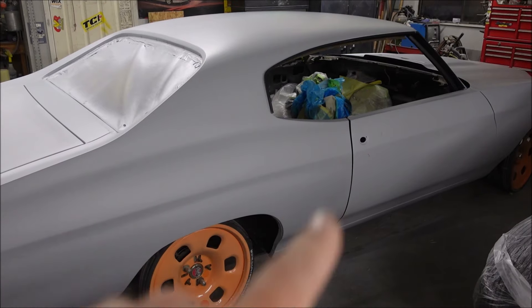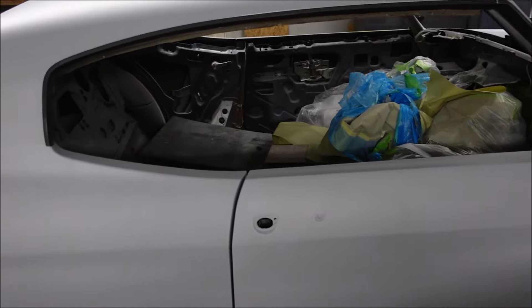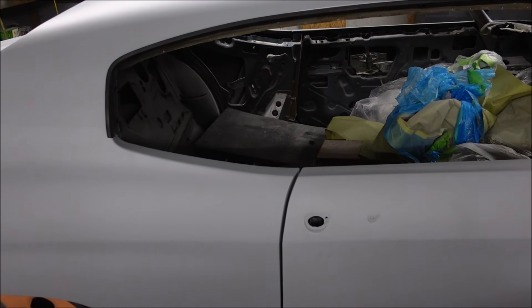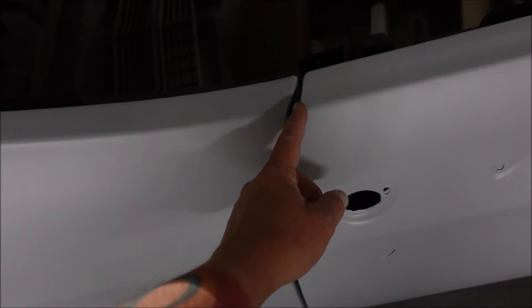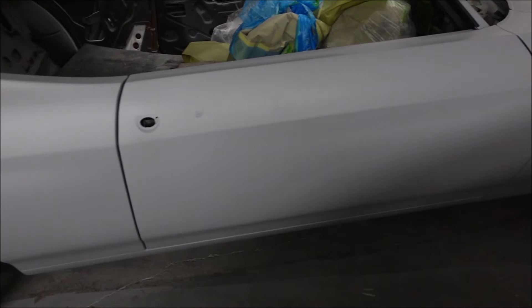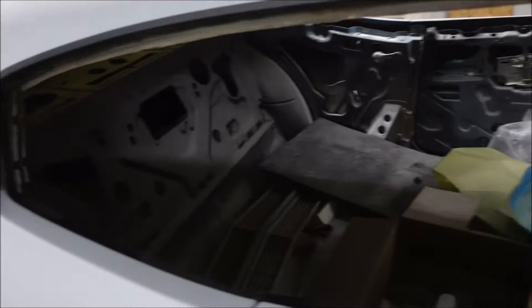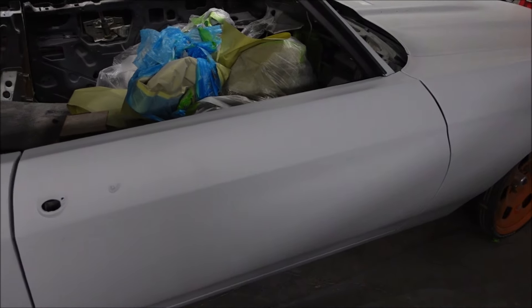You can see my big fat door jamb at the top. I made this car as good as I could without adding metal to the edges of panels to make the jambs or gaps tighter - that's as good as that can get. What I would have done is added a little welding rod to the edge and tapered it in. The rest is fine, but that's just how these are. These are all factory panels on this side, so just how they were.